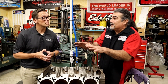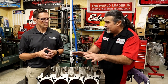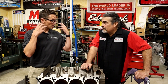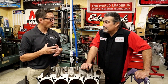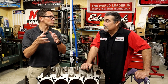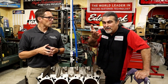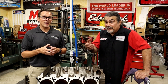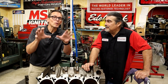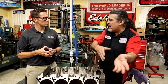Everything today is about more efficiency and quieter cars, so tolerances have gotten tighter and surface finishes have gotten better. That's not scary — it sounds scary, but it really isn't. What I try to do is convert an older vintage engine into a modern world: balance and blueprint it, try to do everything. Some motors you won't do it all the way, but I'll try to go to a 10W-30 and people want to go 20W-50 — that was the best back in the day.